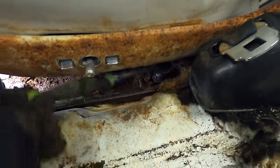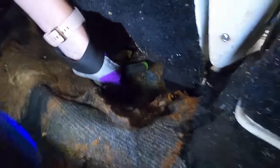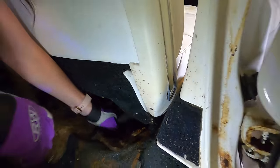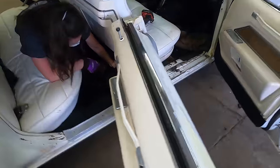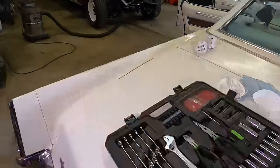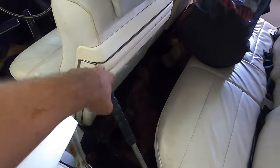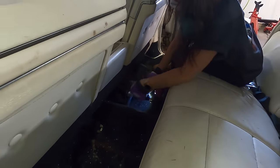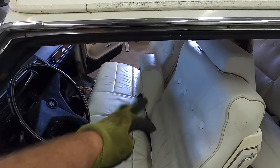And 14 days later I think I almost have one side of the seat unbolted. You've got to just dig in the carpet - found a quarter. This one's the worst, it's way up under there. Oh, it's actually coming easy though. All together I guess there are eight bolts. The carpet is so wet, it's disgusting. So that's the last one. I've got the seat prop holder set up over here - you need these from your parts store and these hold the seat up so when that bolt pops out it doesn't come crashing down. I think we're going to lift the belts out with the seat, just bring her all out one unit.